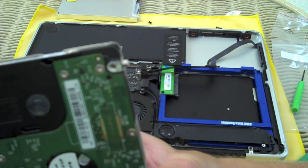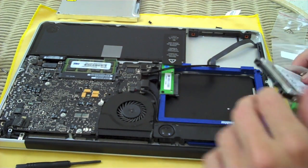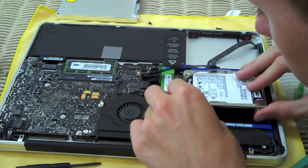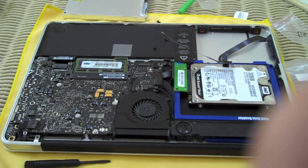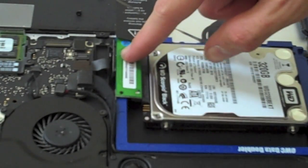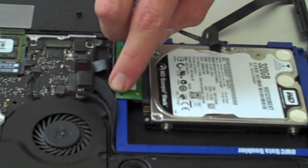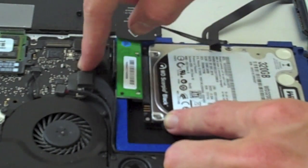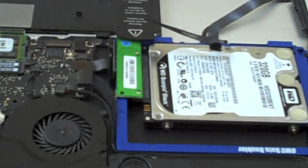These little pegs on the side of the drive that stick out — you're supposed to leave those in. There are actually holes within the Data Doubler where those fit. Minor change of plans: I actually took off the green SATA connector on the Data Doubler. There are three screws — two by the battery and one closer to the fan. Take that off, slide the hard drive in, then put the adapter back on making sure it's still connected to the motherboard. After that, just put the three screws back in and we'll be putting the SSD in shortly.